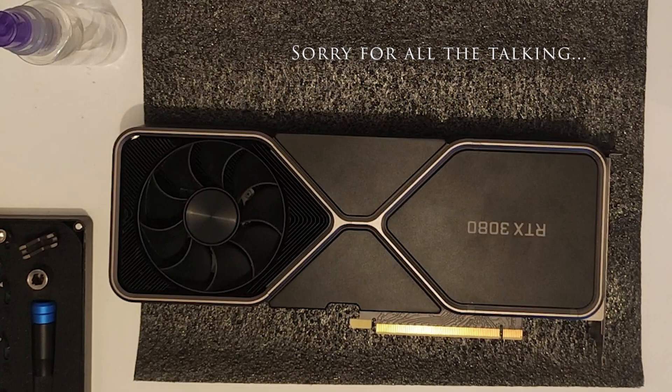If you are in this situation and believe your pads have begun to separate, there is an easy way to check: lightly squeezing the card in the middle should drop the memory temperatures dramatically. In my case it went from 106C to 70C in less than 5 seconds. Please make sure you don't burn yourself doing this because the card will be dangerously hot.